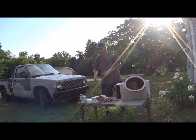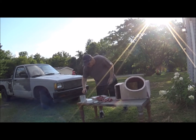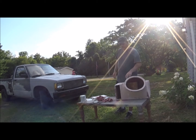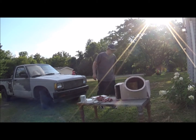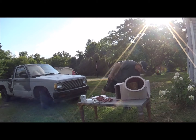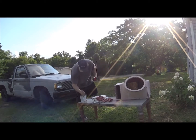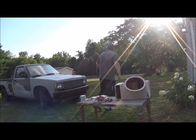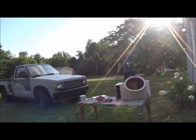Anyways, and I'll have to clean my stuff here, so I got something to use. So I'll let that all dry up, and then I'll get to work. I'll get to doing some more sanding on this after bed. It's going to be a little while. I'll give it about a half hour or so, maybe longer if I gotta. I should have enough Bondo to fill these few little spots, smooth them out, and hopefully get a little bit of primer sealer on it, and then it should look okay.